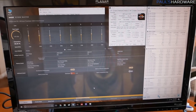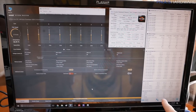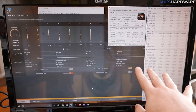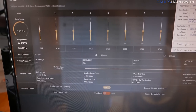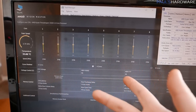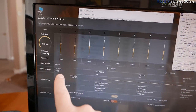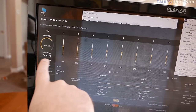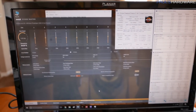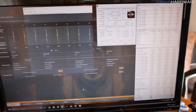The EK water block is currently installed, and this is the idle test. It's just been sitting at idle — I was going for about 15 minutes but we're actually closer to 25 minutes now to let everything settle down. Pro tip: I've discovered something about the Ryzen Master software — if you turn on the active monitoring, it actually takes up about 4 or 5% CPU load and the CPU temperatures go way up. So here's my idle temperature, which has been bouncing between 33 and 35 degrees for the most part, but if you turn on monitoring it suddenly becomes 40 to 45.